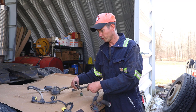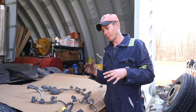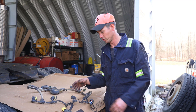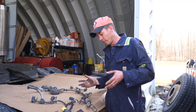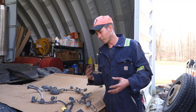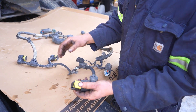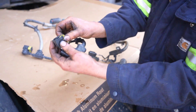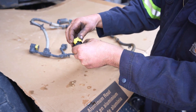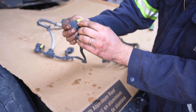The truck I was working on was a little challenging because everything was shifted forward from where they normally are, so I couldn't slither up between the drive shaft and get in there easily. Not to mention it was about 15 degrees outside, so trying to work without gloves and find stuff like this is a little challenging when it's that cold. But like I said, this is a cheap fix. On these plugs for the doser module and knock sensors, they have this little pull-out tab — a lot of times you can get a small screwdriver in there and work it out.